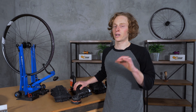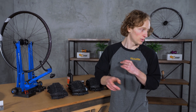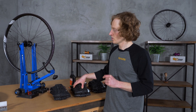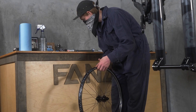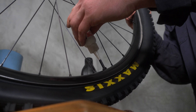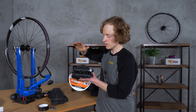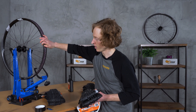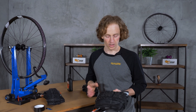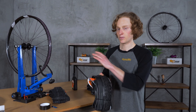Tires play a massive role in determining what our connection to the ground feels like, so they're a really important part of our mountain biking puzzle. These days most mountain bikers ditch the inner tube and opt to run their wheels tubeless. Essentially all we're doing is covering up those spoke holes on our rim with some tubeless rim tape, inserting a valve stem so we can get air into the system, and putting some sealant into our tire before we mount it all up. This prevents pinch flats — that's where you whack a rock, compress the tire down onto the hard rim, and poke a hole in the fragile inner tube. That's not something that can happen with a tubeless setup. You can of course still tear your tire, but these are pretty burly.